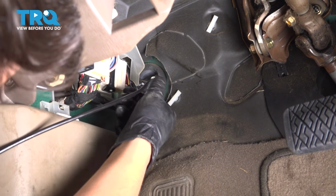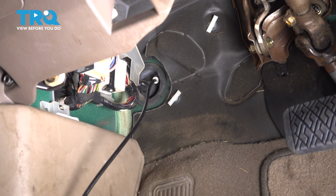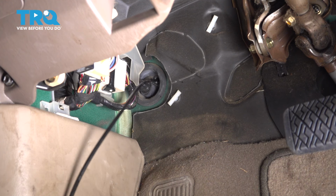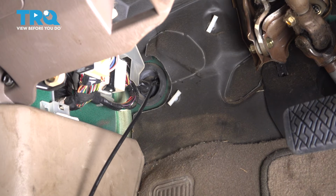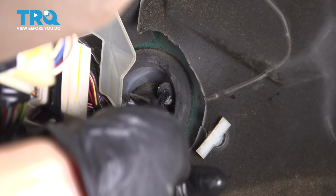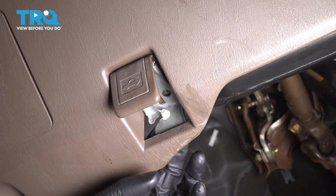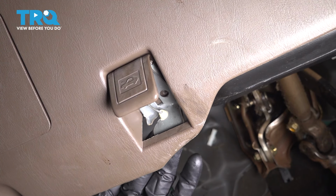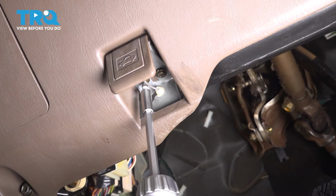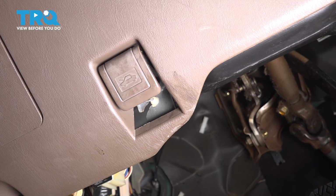Oh, this right here was our stopper. But that stopper does need to pop through and then come back out. Okay, so pop it through like that. And then we're going to have to push it in, pulling on this just like that. So that little stopper piece needs to sit inside of the grommet. Now get the hood latch lever here, pop it into place, and we're going to have to try to start the two screws in. Snug them up. Okay, once those are snug, let's go back outside.